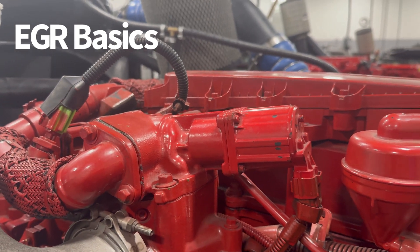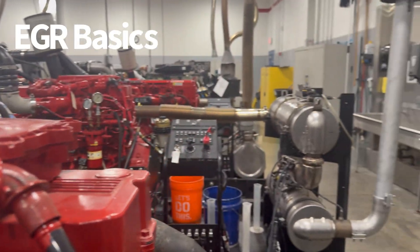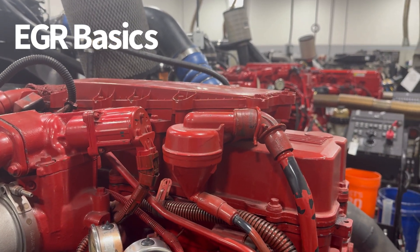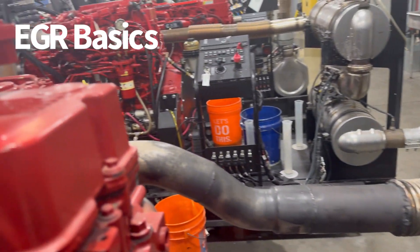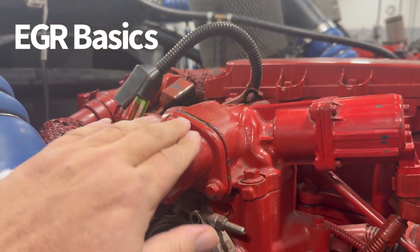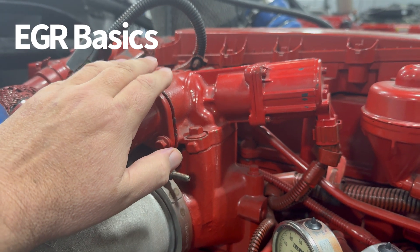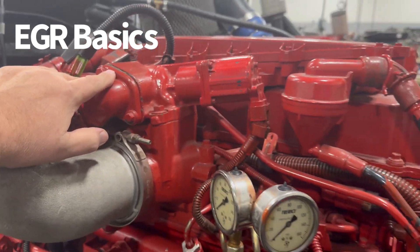So what can go wrong with this system? Primarily, as we know from other videos on this channel, you can see the diesel particulate filter. We need that filter because of all the black nasty soot that gets pumped out of these engines. On this engine we actually collected exhaust before it went through that DPF cleaner, which means all that nasty soot is coming in through this valve and getting into our cylinders. It's one of the reasons why you need a special detergent package for these engines — that soot gets in your oil, your sleeves, your valves, and causes all kinds of issues.